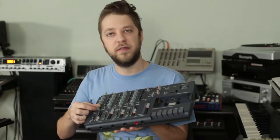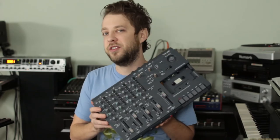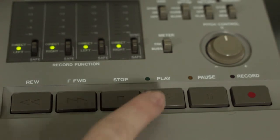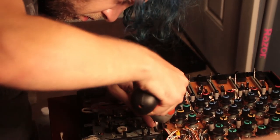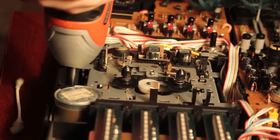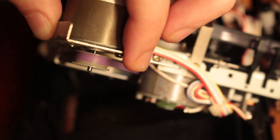The nature of the analog beast is that parts age and go wrong, but with proper care and maintenance these will last you endless hours of recording time. The most common problem with broken tape machines is that the tape transport won't work because the belt inside is broken. This is a relatively simple repair job and I've repaired a few myself. You can purchase replacement belts easily online, but make sure you're getting the right size for your model.